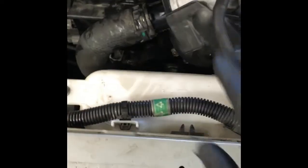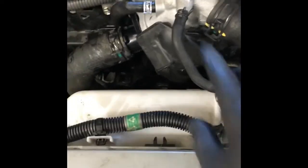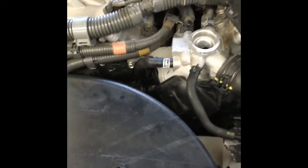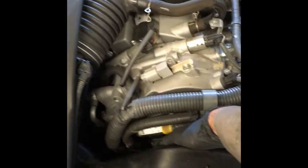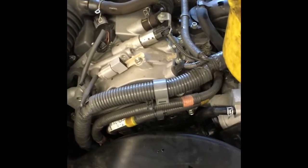After installing the lower radiator hose, go ahead and reinstall your coolant overflow bottle and the vent hose and the overflow hose. Then install the snorkel, and after that we're going to fill it up with coolant — right here at the thermostat housing. This is considered a self-bleeding system. Now that you've got it all back together, fill it up with coolant and let it run until the thermostat opens. The way to tell is by feeling the lower radiator hose — you'll feel it get hot. Check for leaks with a flashlight at all the surfaces you touched. Also run it long enough to make sure the cooling fans come on.